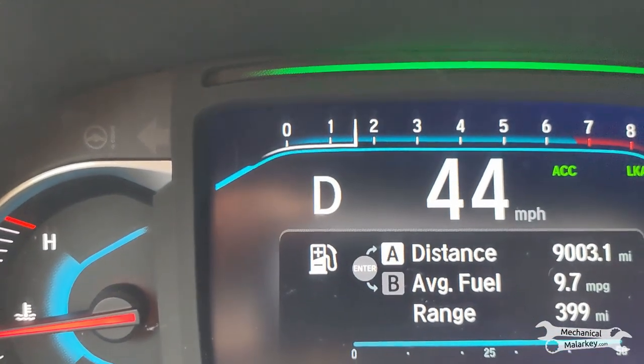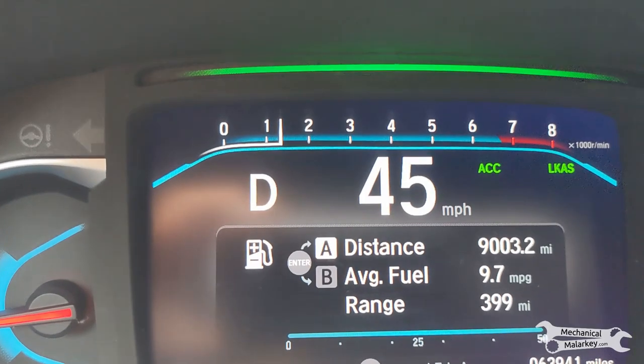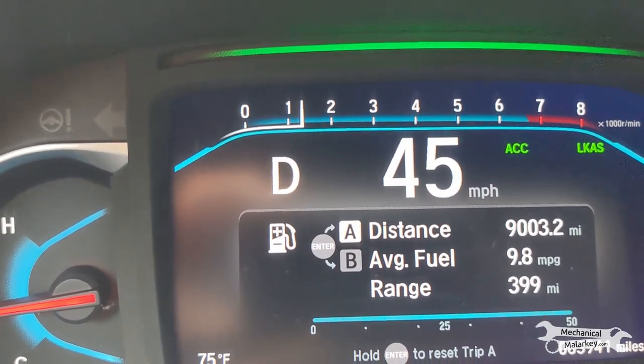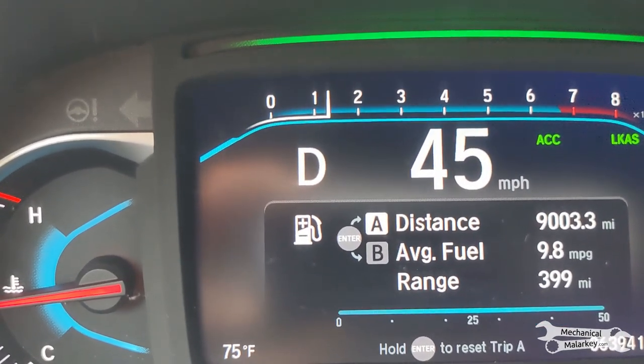You'll get up to around 40 to 45 mph when you're hitting that range. Usually around there the car will automatically shift up to third for you if you hold it there too long, but usually right around then the EGR monitor has already set.